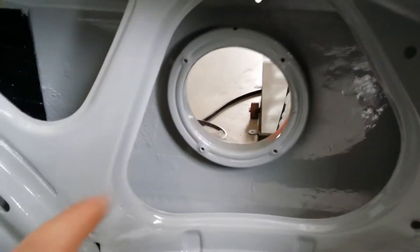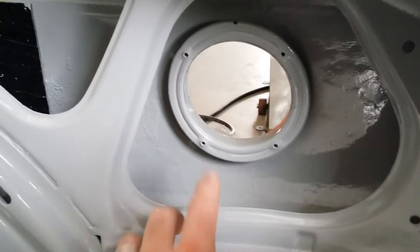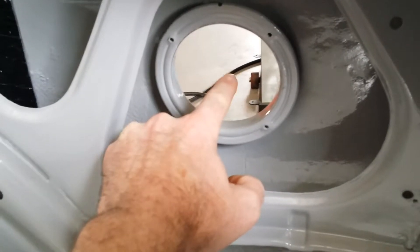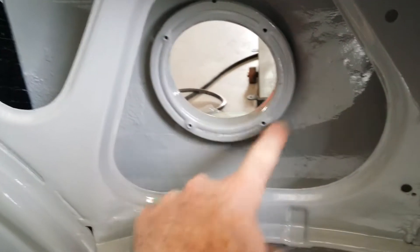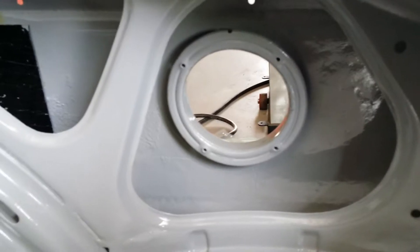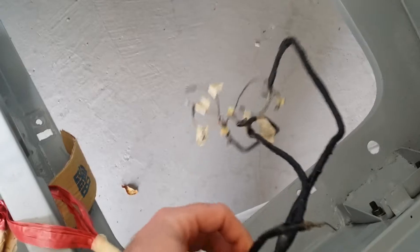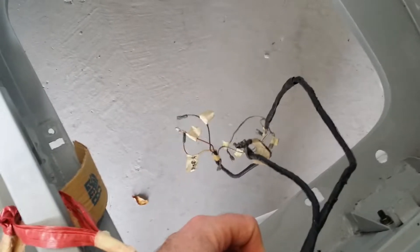Going to the fuel filler — we have the rubber neck that leads to the pipe which leads to the tank. We have the metal interior that the cap screws into, but we don't have the circular metal surround, so that also has to be sourced. BMW don't have one. I haven't done all the wiring yet. There's a lot of things to go in the interior to run the wiring loom properly before I can secure that. I've basically just got the ends of the loom roughly in place, but some of these connections — the float for the fuel tank and the rear lights — obviously without the fuel tank in and things, I can't wire those up.